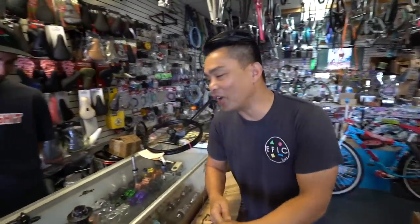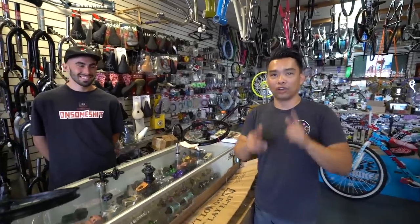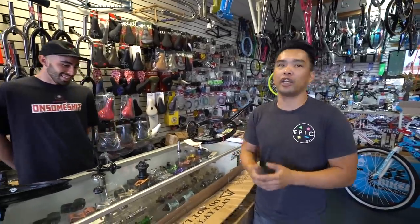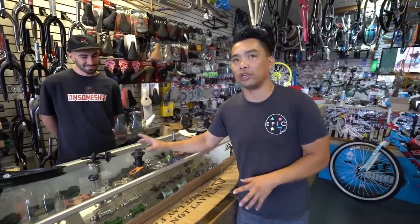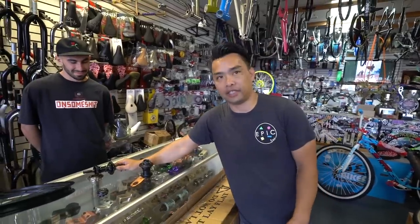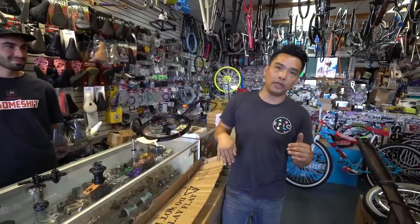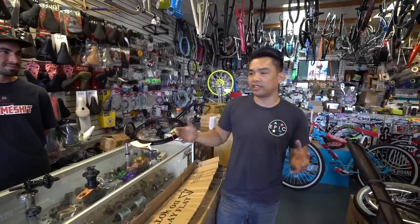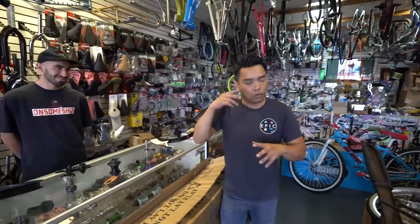I'll rewind this. Okay, so James Foster, one of the gnarliest dudes. If you guys aren't familiar, go look up James Foster, Ninja Circus, X Games winner. Even he says that a Freecoaster is way faster than a cassette, but why does he ride a cassette? Because of the way he rolls in on the roll-in, he's so accustomed to the cassette and how much friction it has that he knows exactly how many pedals he has to take and how much he has to tap on the brakes. If he has to go on a Freecoaster, he has to readjust.